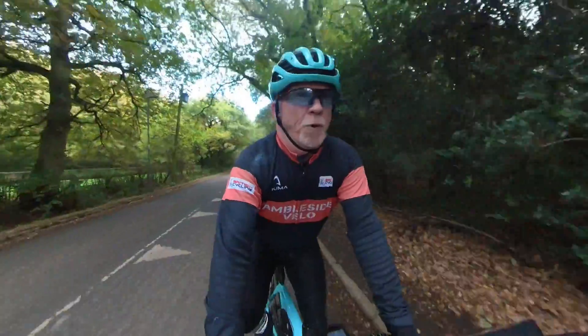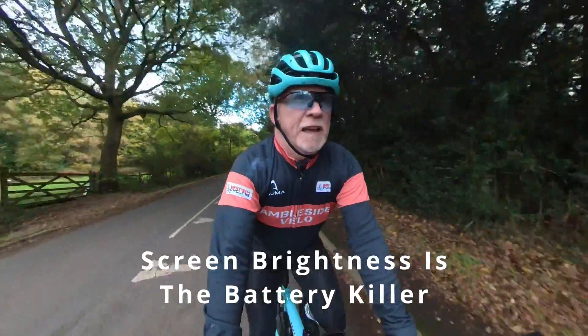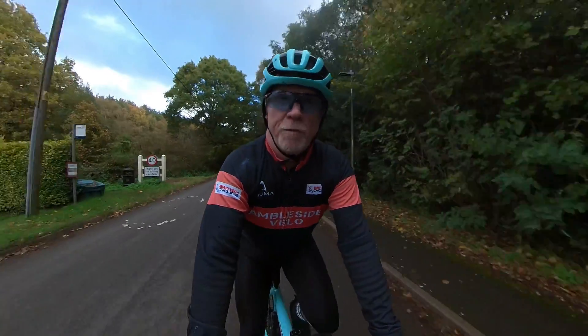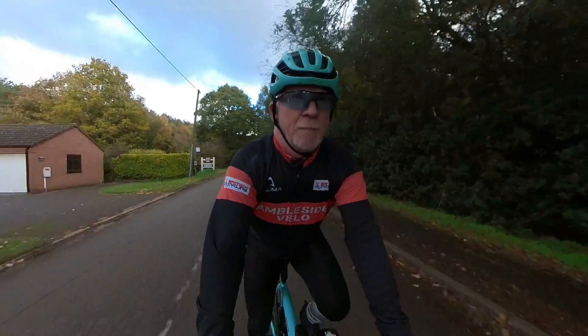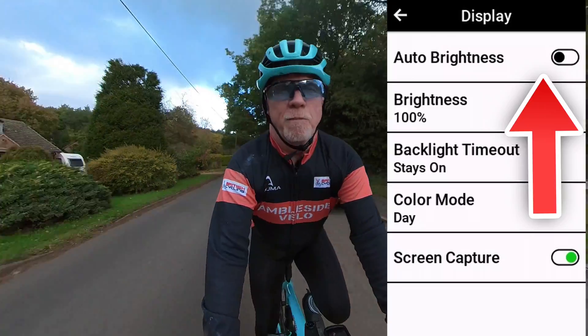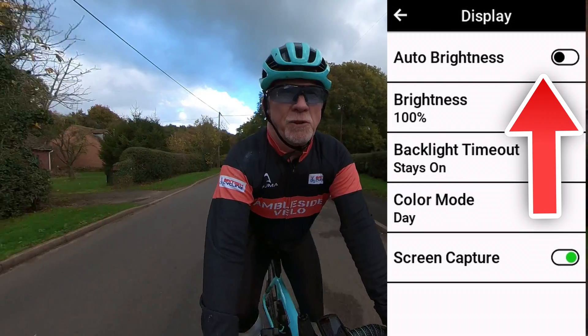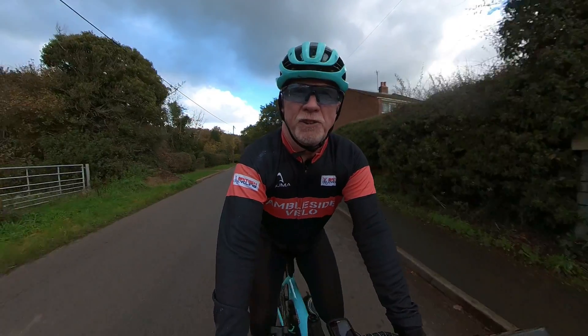The most important point to bear in mind is that the single biggest thing which will drain your battery is the brightness of the screen. I do prefer mine to be fairly bright, but to have any hope of achieving the 45 hours, you must have the setting on auto brightness. I let the unit sense the ambient light and adjust accordingly.